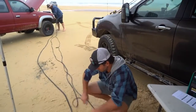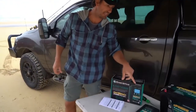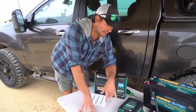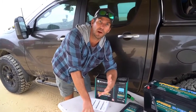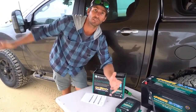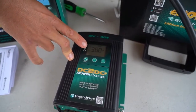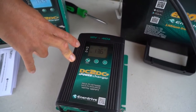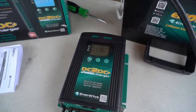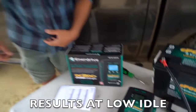This unit, the e-power DC to DC, is actually capable of punching out 50 amps. With this big 16mm cable we should get well above 40 amps once it kicks in. You can go even bigger if you want, but you'll see here when we punch out well over 40 amps it's probably about as big as you need to go for a good 10 meter run, which is what most people do from their car to their caravan. At idle it's nearly — look at that — 38 amps just at idle! Ramp it up and we'll go well over 40. High idle: 42 and a half amps.